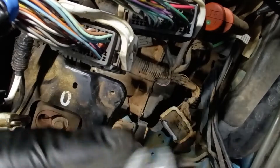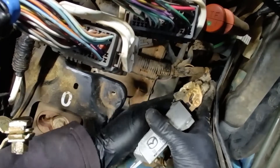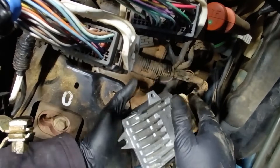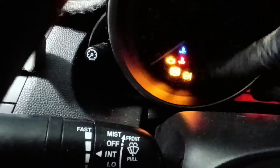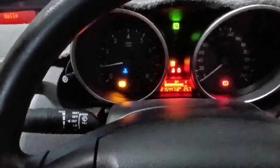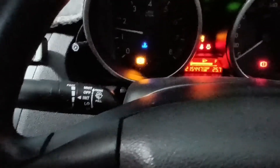Okay, let's try this one — I hope it will work. I'm going to push it in. Remember this one here has to align because you don't want to break it. Just put everything back and try to start it up with the new TCM and see how it is. It used to have the DTC on all the time. Don't worry about the ABS light because the pump is gone, but the check engine light is off.